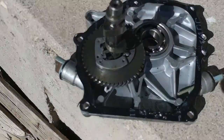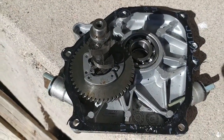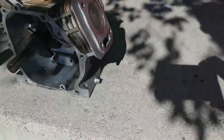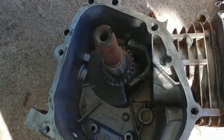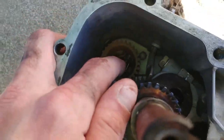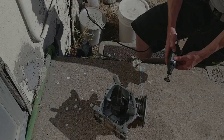So like I said, here's our new crankcase cover that I ordered from eBay, thanks to my helpful subscribers. And we're gonna slap that bad boy back on this engine casing and see if we can get it all mocked up. Okay, so what I've decided is I'm gonna cut this governor arm off and then pull that governor gear out.